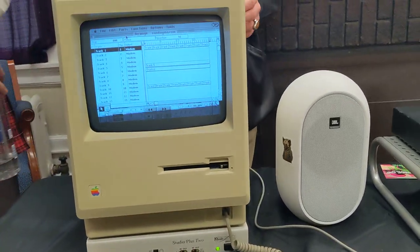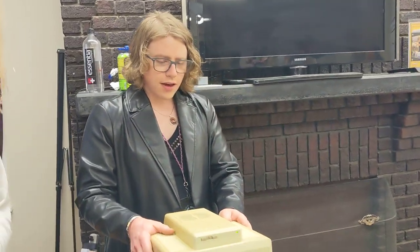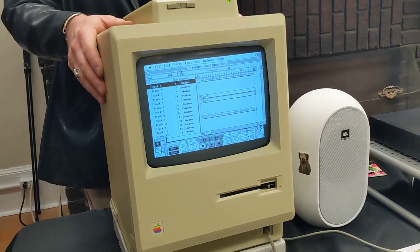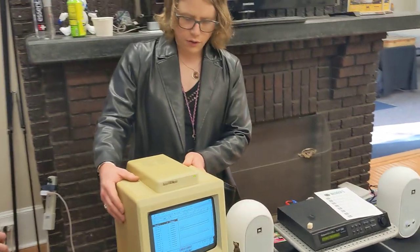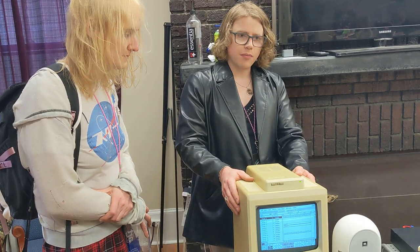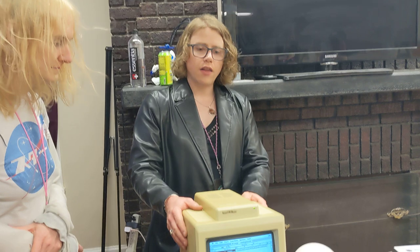Mac Donna is the 3,061st Macintosh manufactured, the week of May 21st, 1984. In 1986, she was upgraded from an original Macintosh to a Macintosh Plus with 1 megabyte of RAM. I inherited her from a colleague at the Danbury Hackerspace in December, and I upgraded the memory to 4 megabytes and restored the original analog board.